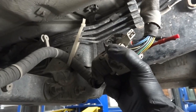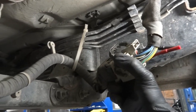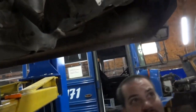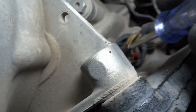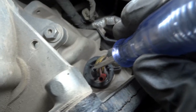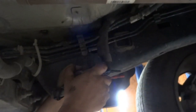I'm going to get two zip ties and zip tie this really well. You hear the beep? So now the transmission module is talking. Can you put some pressure on the connector first before we zip tie it? Now as you're squeezing it, I'm going to check these two power wires at the transmission module. Now we have power at the first power supply wire — now let's check the other one. We now have power on both wires. So now if we go inside the truck, the truck will start. Let's put some zip ties on that connector and see what happens.